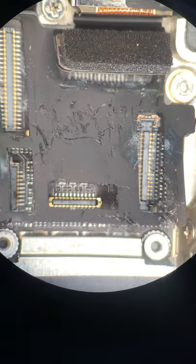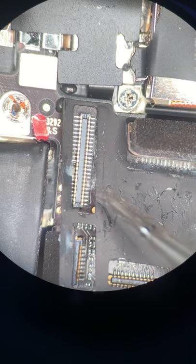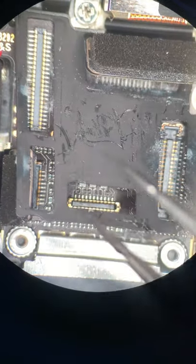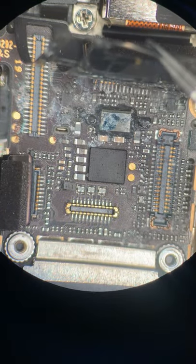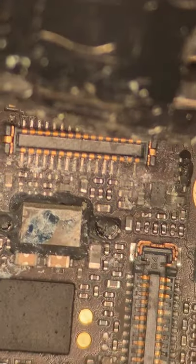So the new screen didn't work either — the touch screen wasn't working. I took a further look at this and it looks like there's some corrosion on the connections where the screen connects into the motherboard. And after pulling off this little IC cover, look at that. This repair is going to take a lot longer than I thought.